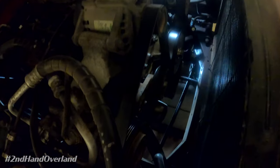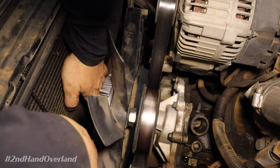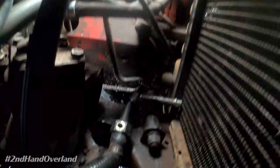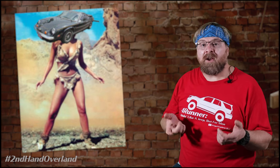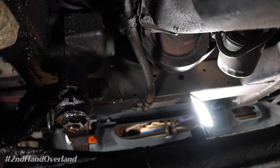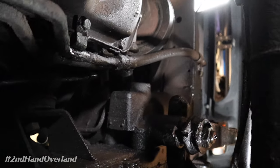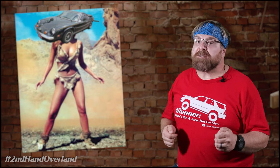For better filming and to accommodate my oversized American arms, I went ahead and removed the fan and fan shroud to get at those front connections a little bit easier. The only tools you need are the 36mm fan wrench and needle nose pliers. Take the fan off as you normally would, then pull the two tabs off the front of the radiator shroud with needle nose pliers and slide the shroud right out. Pull the temperature sensor off the line going into the bottom of the radiator, disconnect it, remove that line, and replace it with the new one. Connect it to the transmission end first before the radiator end — it gives you more flex and play when reconnecting underneath.